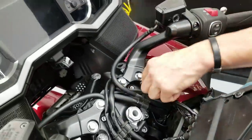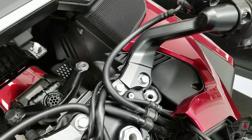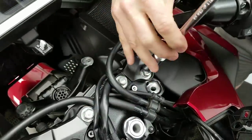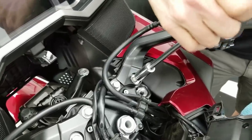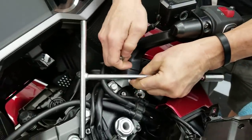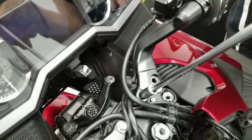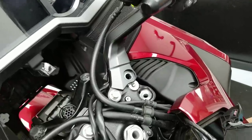I want to show you a small problem here: it's easier without the rear handlebar bolt in because you can't really get a straight shot at this nut. So it's easiest if you have this outer or rearward handlebar bolt removed. Be careful with your hardware — the bike will eat it. You can loosen this bolt, the handlebar will slide up, snug it back down so it stays out of the way. Makes it easier to work.